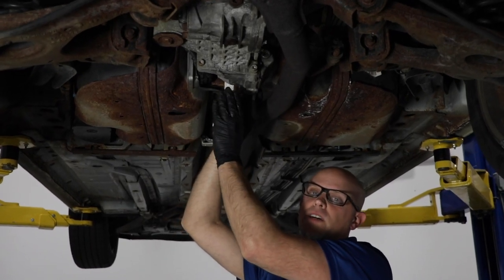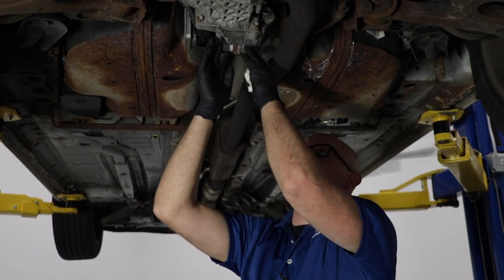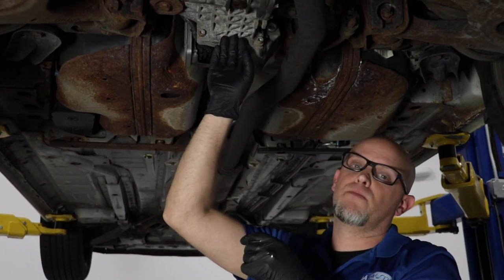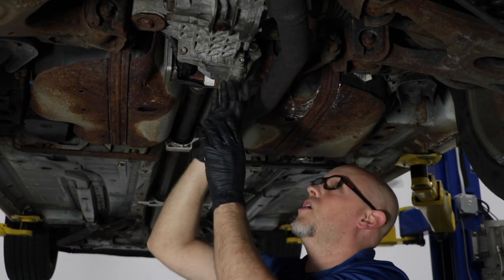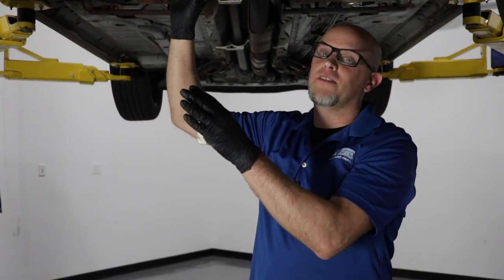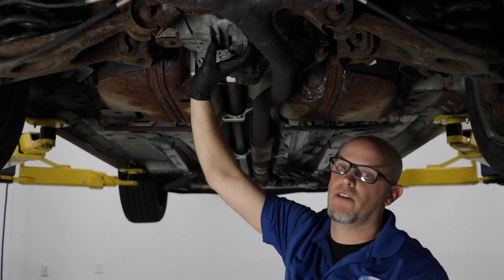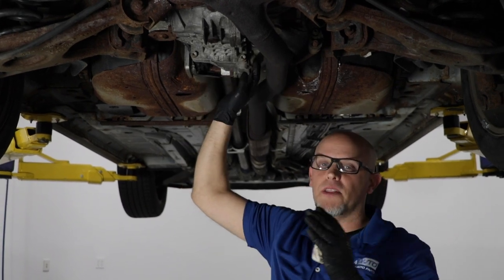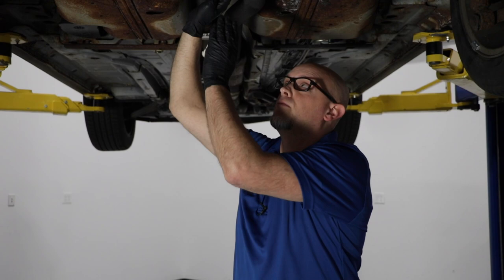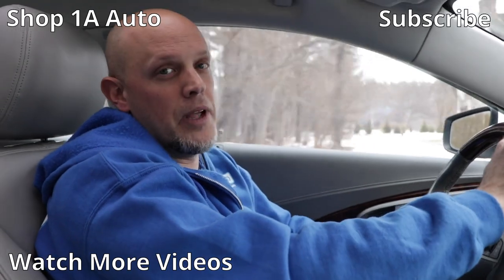If the fluid was low in the clutch area, there are only a couple of reasons: either there's an external leak we would see, that seal is bad and fluid is going back into the rear diff, or someone serviced this and did not put the appropriate amount of fluid in. We're going to drive this car around and see how it does. If fluid continues to go into the rear differential, we'll have to address that seal. There are 100,000 miles on this car — that fluid could have seeped back there slowly and may not be an ongoing problem. We'll drive it for a couple thousand miles and recheck the fluid level; we may have to replace that seal, or it may be okay.